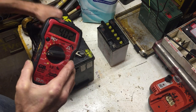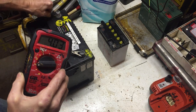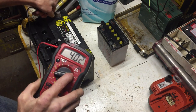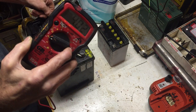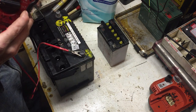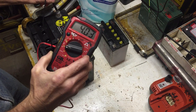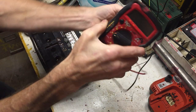I said what the heck, I'll try it — I don't need this battery for much. It's honestly going to sit around since I don't drive much. Living in the beautiful state of New York that likes to tax the sins right out of your soul. Anyway, back to reality: it was at 3 volts, I dumped it, rinsed all the garbage out, put purely the Epsom salt solution in it with no charging, and it's already at four volts. Pretty interesting.